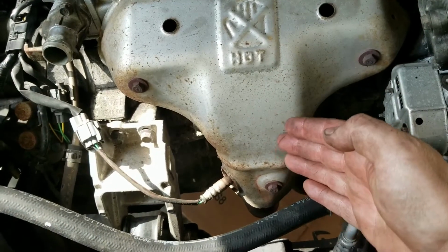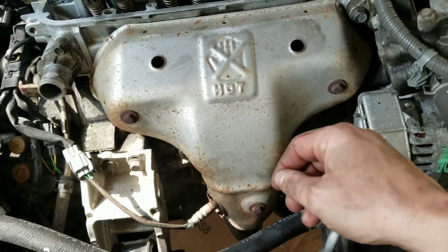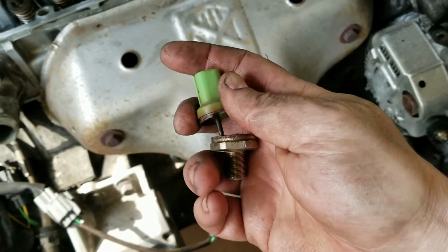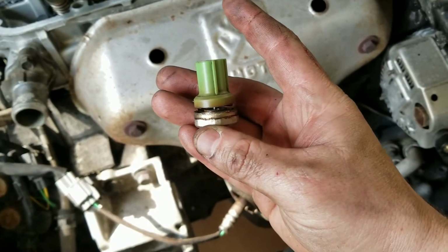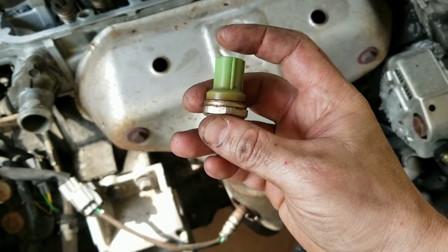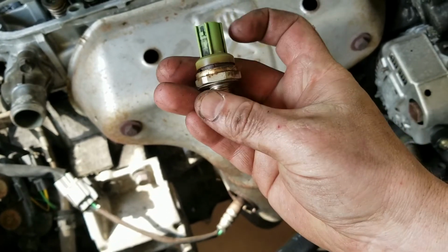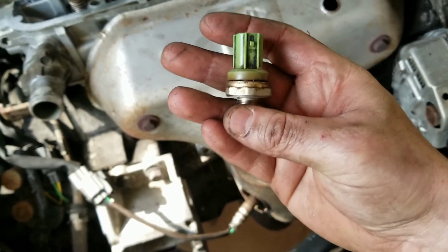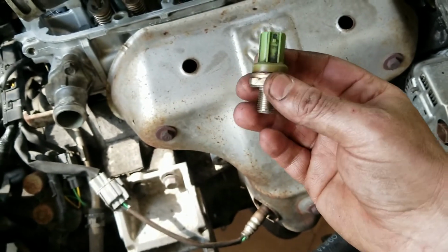We got the exhaust and everything hooked up. Pretty much everything up underneath is done, except for, of course, the knock sensor, because I had noticed that the knock sensor was just split apart and barely hanging there. And you know what, I very well could have done that, but I am really careful about disconnecting plugs and whatnot. But the plastic on the bottom of this is just so fragile that it probably would have broke eventually if I didn't do it.